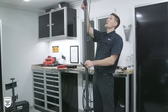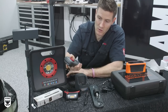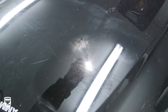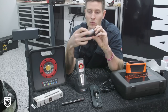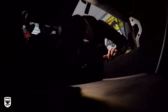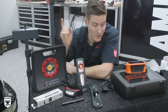Why is adjustable lumens important? Let's talk about light absorption. If you have a light-colored car like a gray or white Audi and you put a certain amount of lumens on it, sometimes it'll wash it out — there's no contrast for your eye to see the scratches. If you can't see the scratches, you're kind of useless as a detailer in terms of removing paint defects. You can manipulate the light to see different scratches. They also have a headlamp you can hook into your belt, which is cool.